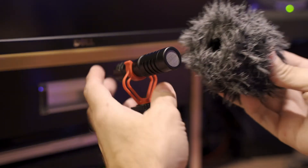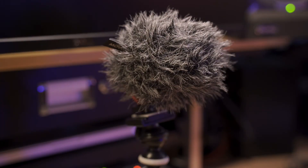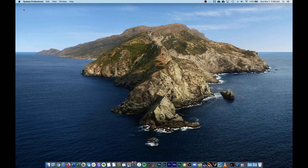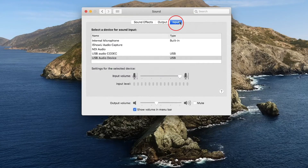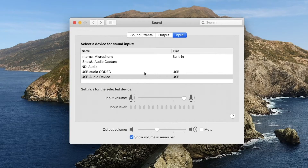But just be mindful and try to keep your mic from pointing directly at any speakers. I would also recommend using the included fuzzy windscreen. It looks a bit silly, but it will block any wind coming from a desktop or ceiling fan, or if you happen to be breathing directly at it without noticing, it will block your breath from distorting the microphone. Once we have the mic plugged in, we'll need to tell the computer which mic to use. So if you're on a Mac, you'll need to open System Preferences by clicking the Apple icon in the top left corner, clicking on System Preferences, finding the Sound icon, then clicking on the Input tab, and selecting the Ugreen USB Mic Adapter, which is actually called USB Audio Device.